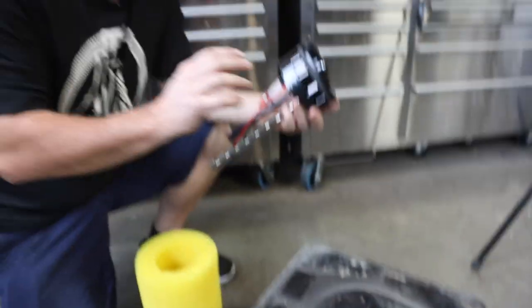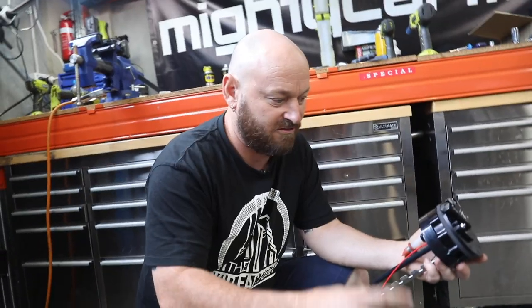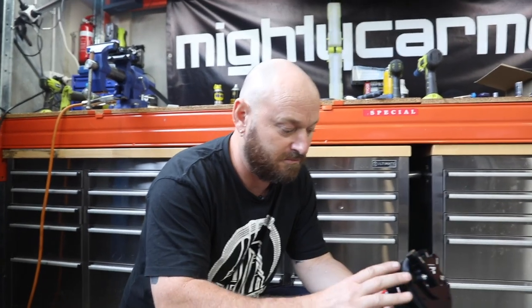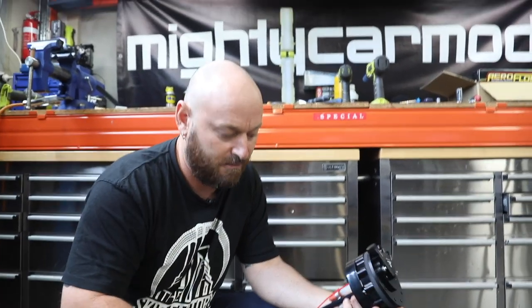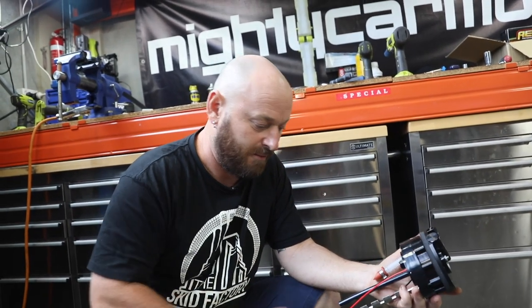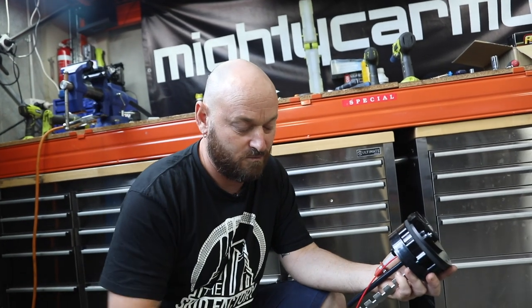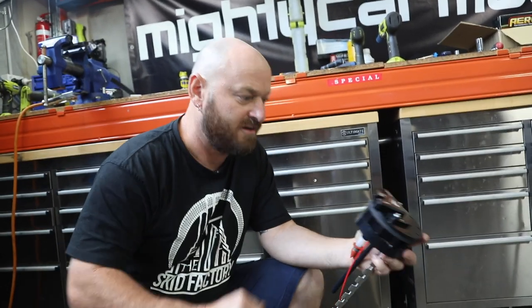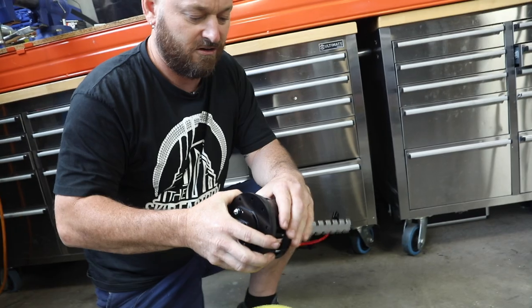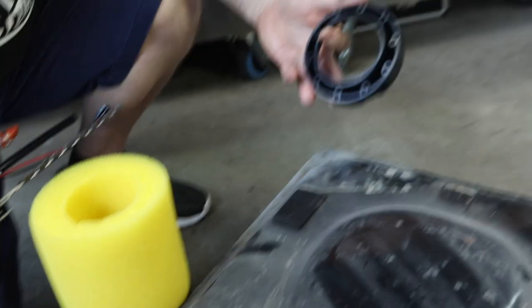Yeah. And is there enough depth here for this, or do we need to modify that and cut it down a little bit? There's a minimum depth, which we're fine with. It's six inches, 150 mil minimum height, up to, I think, 12 inches, 300 mil maximum, to get the pump to reach. This thing you just trim down depending on what height your tank is. This is actually a template, looks fancy.